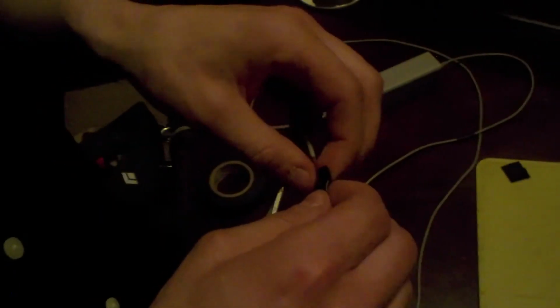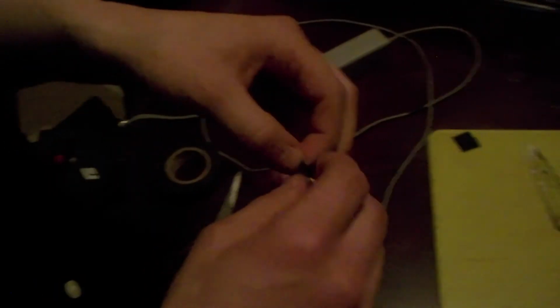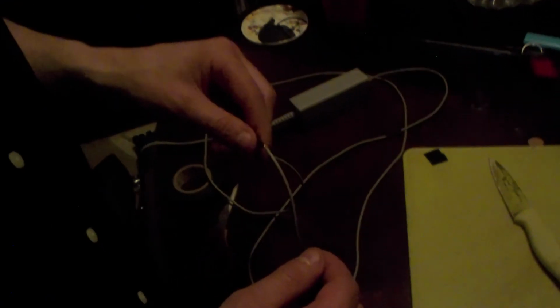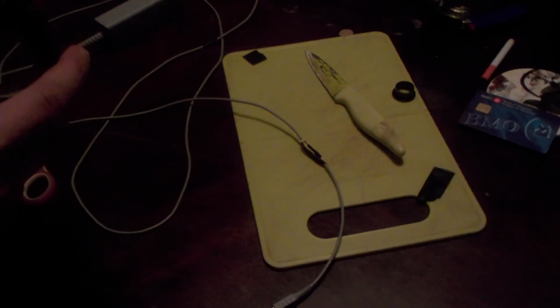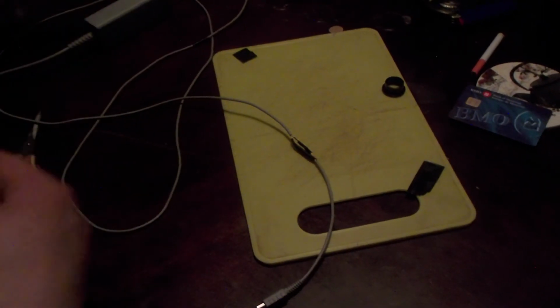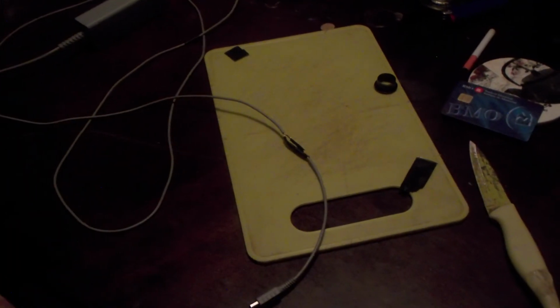And make sure, guys, when you're doing this, don't leave any wire exposed. If you don't have a soldering thing or an insulation tube, just do your best to wrap it up with electrical tape, because you don't want any exposed wires around your house, and I don't want you guys to watch this video and end up making a big mistake with your electricity. You might start a fire, right? Always best if you know somebody that has at least a general idea of what they're doing, get them to give advice to you, or, like you're probably doing right now, looking up stuff and researching into it, because why go into something blind, right?